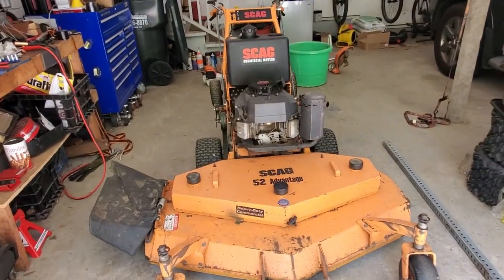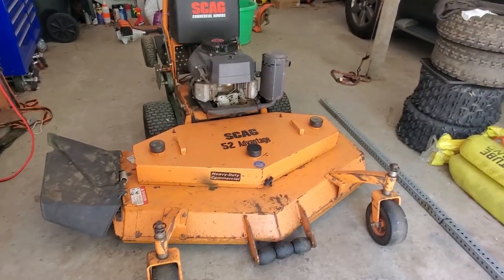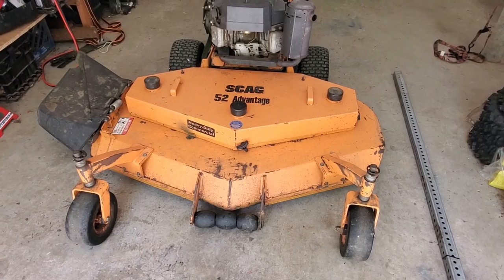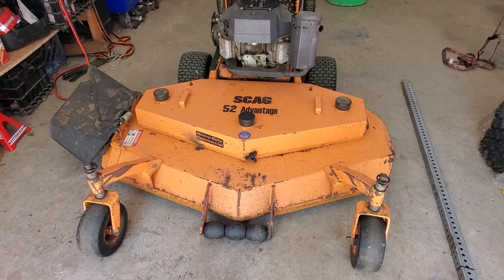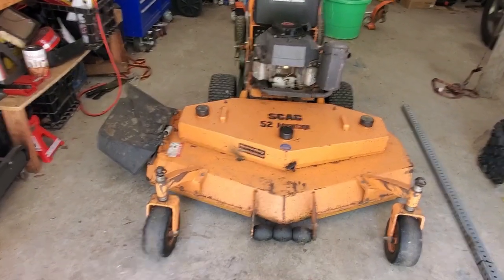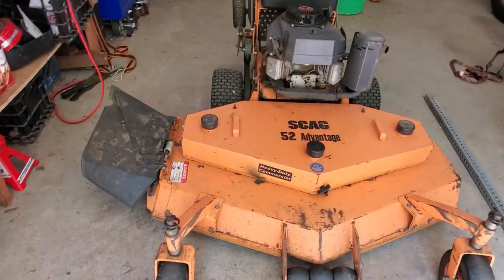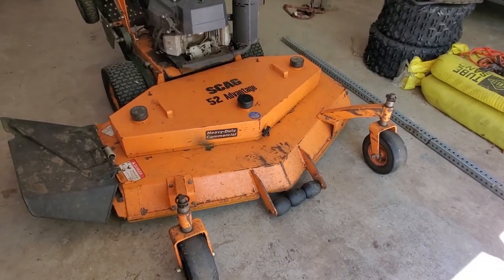What I'm going to be doing today is some maintenance on my Scag walk-behind mower. I have a couple of issues with it - one being it's not cutting well at all. I thought my blades were dull, but after I sharpened them and went out and tried to cut, it still wasn't cutting well. So I think the deck pitch might be off. I looked in the manual and the number of spacers between the blade and the spindle is off. I also want to see if I can adjust the baffle.